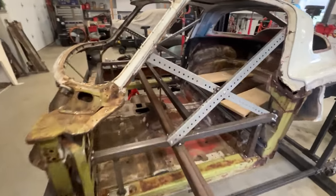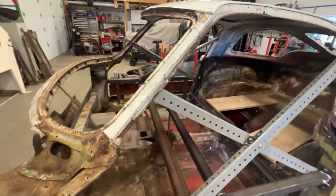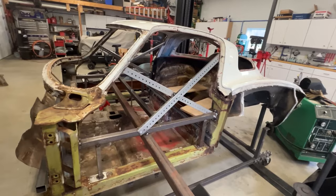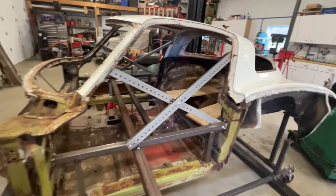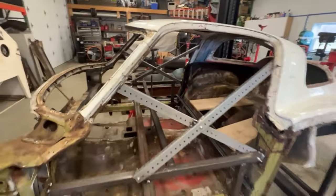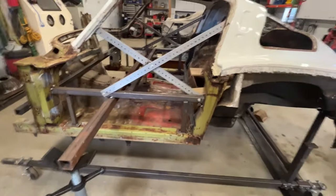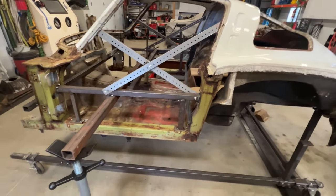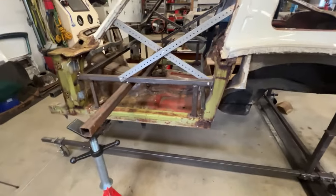It's not quite as difficult as what Mitch does because he's got a lot of pieces. I have a pretty solid coupe birdcage on top that's going to hold some stuff in place, but you never know what kind of built-up energy is in those pieces until you cut them loose. If I were to cut this post here, it doesn't necessarily mean that post will stay lined up — it could spring up or spring down based on what energy is built up and how they welded it. If you guys have done anything like this, you know what I'm talking about — you cut it and all of a sudden the thing springs up. That's why you do these cross members and take measurements. I may have done overkill — that's okay. We're going to start getting into these rockers now. I think we're all braced here. The next thing we're going to do is start cutting these rockers off.